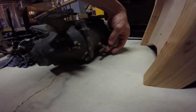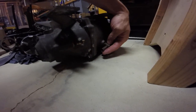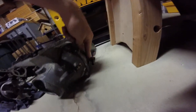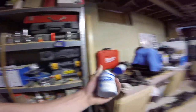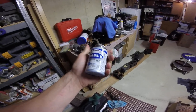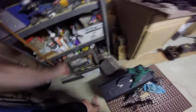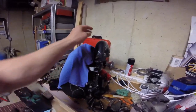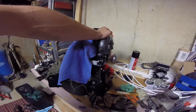I've got another pump over here. This one actually has a large fitting in it, but you can just take the ride plate off and twist it out. This is not a stock fitting — yours will look different. Pull that fitting out, drill both sides, then use pipe thread sealant, throw a little bit on there, thread it in, clean up the sides, let it sit, and you're good to go.